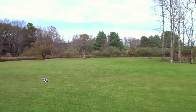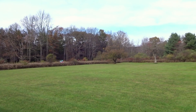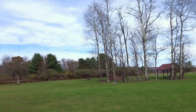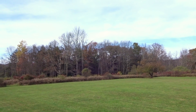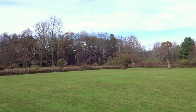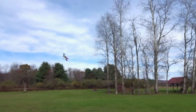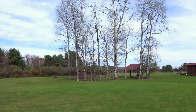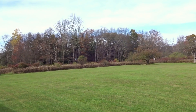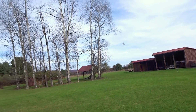So this has rates I'm not familiar with - I forgot to change them, so these are the stock Betaflight rates. These are actually pretty decent rates though. If you are a beginner I'd actually recommend staying with the stock rates until you know more about what you're doing when changing them. Of course you can always fall back if you mess them up, so it's always good to experiment. Right away flying this I definitely noticed just how smooth it is - those DYS motors with the large air gap make for some really smooth flying.